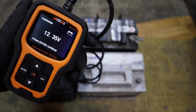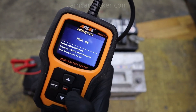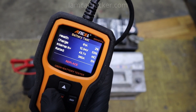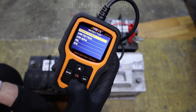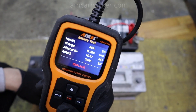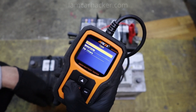I also had two other batteries in the garage. One was a simple battery — I tested it and it got a health of about 2%, so the result was 'replace.' And then another battery, this is AGM, so I selected that in the menu. For this battery I got the same result of 'replace.' No surprises, because these are two batteries I had already replaced before for my older vehicles.